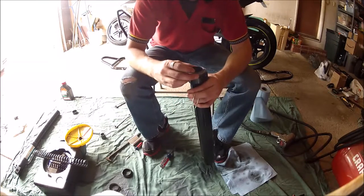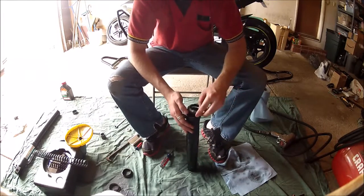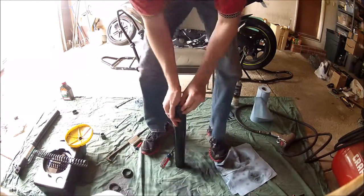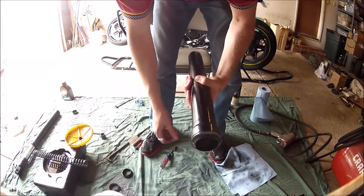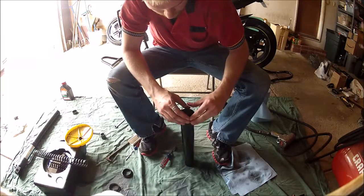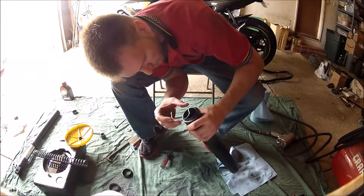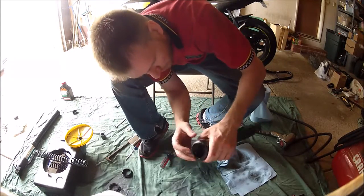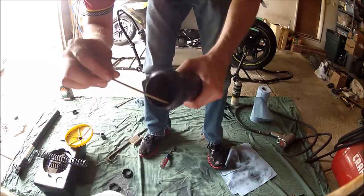After the fork oil seal is driven into place, you can apply the dust boot cover by hand — you do not need a seal driver for this portion. It will only go into place one way. Once it's put into place, go ahead and take that snap ring and feed it through. You can easily find the lip to place it into and it'll snap directly into place. Once the snap ring is in, take a small screwdriver and just run it along the bridge line making sure it's seated properly.